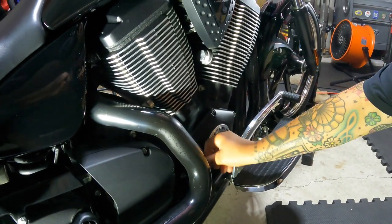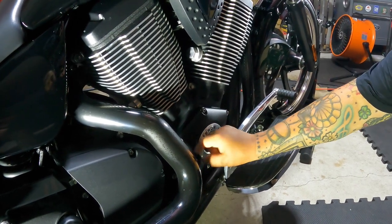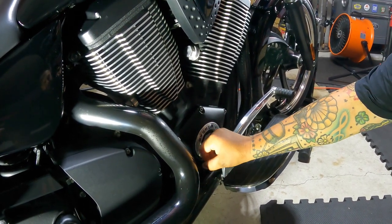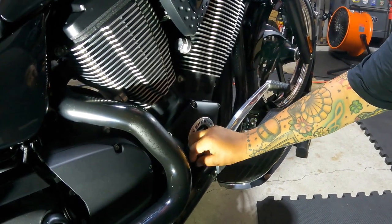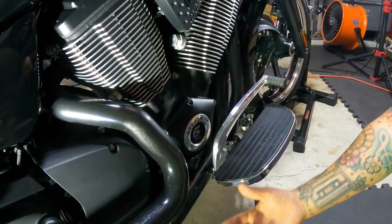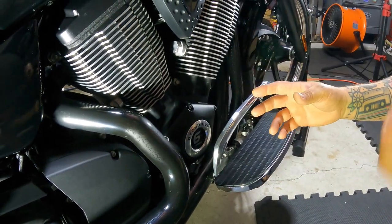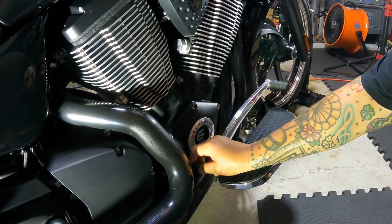Now we're going to fill. What I was going to say at the beginning, which I didn't, I'll tell you now. I like to crack this, your dipstick oil cover, open and let a little air through as I'm draining. That way there's no vapor lock or whatever. There's no airlock in the engine preventing the oil from coming out real smooth.